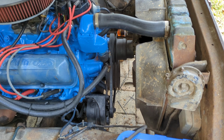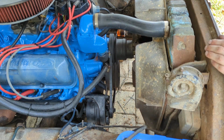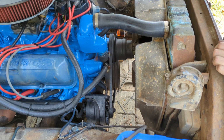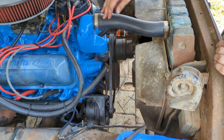Belts on, upper rad hose bent. Spared you the expense of watching me flounder around down there. But was able to crawl under, take one breaker bar and wedge the alternator to gap it, tension the belt, and then was able to take my other arm and wrench down, tighten it. I got what I assume to be the worst of the hoses on. It really wasn't that bad.